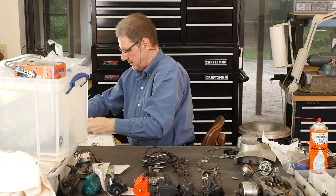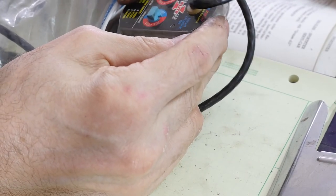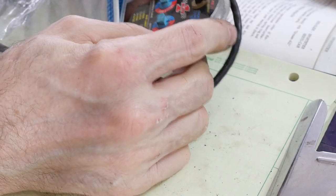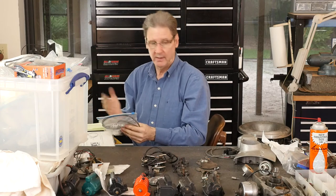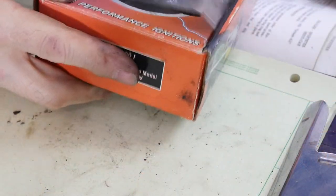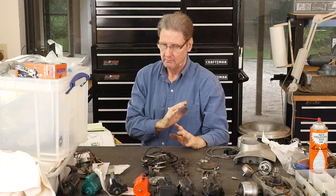Here is — I think a CompuFire — programmable advanced, HDE3. RPM limits, advanced curve. Same thing: you want as much advance as soon as you can get it. A lot of that curve setting is how quick the advance comes on. Sportsters with this crappy flame front and this horrible piston shape — this Dyna, I think this is the Dyna that might be out in the 77. I had a Dyna that may have blown up my bike, but that would be my fault because I probably adjusted it — just 'oh, it idles nice and I can kick start it, it doesn't kick back' — so I may not have had that 40 or 45 degrees of advance. I didn't read the manual.